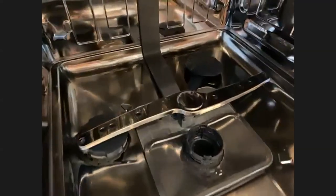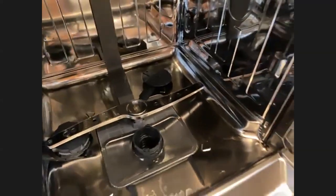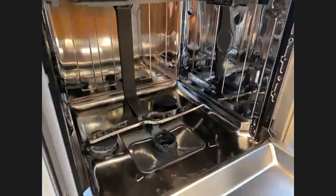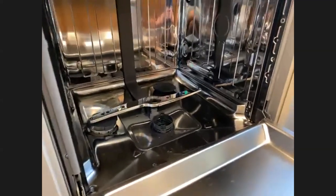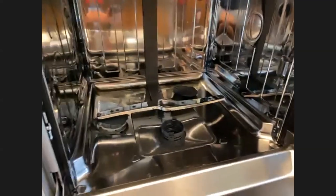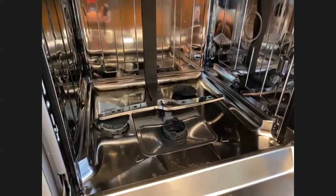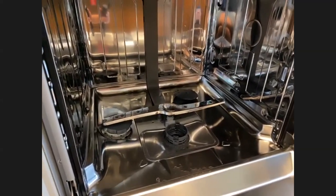Today we use a flow through inline water heater. And guys, just so much better than before because it actually provides a more accurate water temperature. It's fast and it is way more energy efficient than the calrod used to be. And I know I'm not the only one who lost a wooden spoon to a calrod heating element in the bottom of the dishwasher years back.